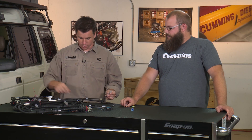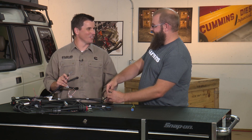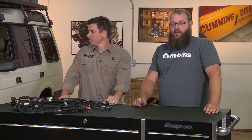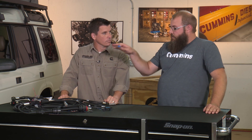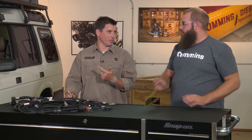So where do I plug this in? I'll put the terminating resistor right back in the harness so we don't lose it. You're in luck because on the engine we do have a three-pin connection point right in the front of the valve cover, much like we have in our test vehicle beside us. So — two pin, three pin — what do I do?